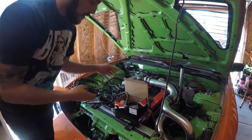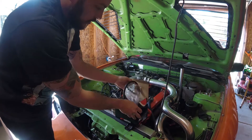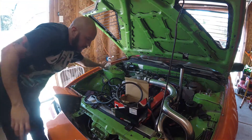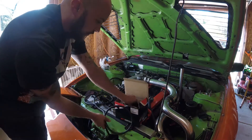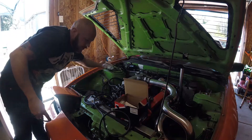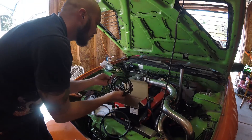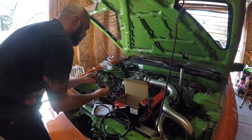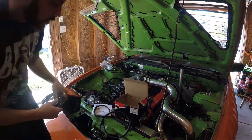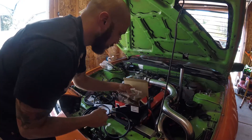The harness for the IAT — I'll lay that over the hood. This is the MAP sensor harness. We've got a boost control solenoid — we're going to mount that over near there. We're just going to basically group stuff where they go. Oh, it came with a MAP harness too — now I've got two, that works. I'll keep that in the box, I'm not going to need it. Got my IAT here and my MAP sensor.